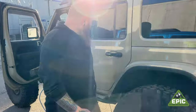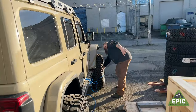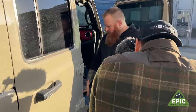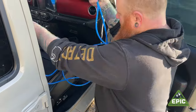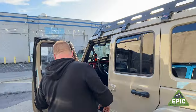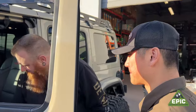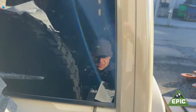Those are disconnected, so we go to the other side. Now that we're all disconnected, come over here — there's the purge valve. Now we've purged the lines, they're easy to disconnect. And if you get them just right they usually coil really nicely. Then you stick your plug back in — normally it only comes with one plug but I just put the plug back in. If you wanted to air up a buddy, you pull up here on the other side, but you'd have to plug the opposite side you're not using so it doesn't just send air out.